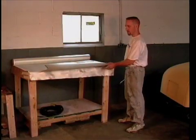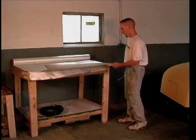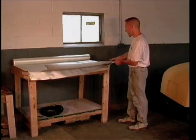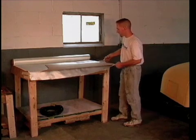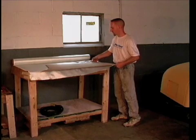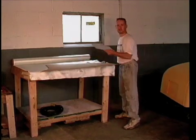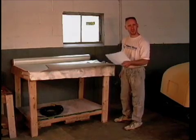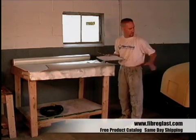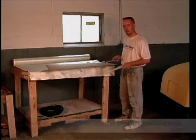Keep any template you've developed at this point because they come in handy later. I'm going to cut the fiberglass for the sides so that I don't waste material — I'm going to follow right along the template and cut it a little bit oversized so it overlaps where it hangs around the contour. The other template I'm going to keep is the license plate template because I'm going to make inlays when I go to put it in the car. I'll pre-cut some fabric, work on the sides first, then drape one layer of the cloth straight down over the back of it.